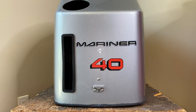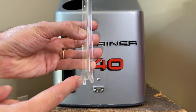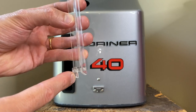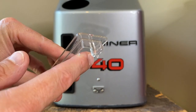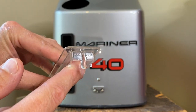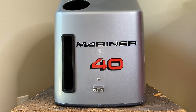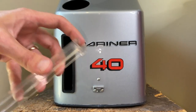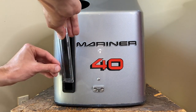The last thing you want to do is force that acrylic lens into this rubber seal without lubrication and break it. Not good. However, directing our attention to the acrylic lens, and you've got this little slot here, as you see. And on the opposite end, a little tab or probe. And that is what that aluminum plate and lock washer seat onto inside the cowl to hold it in place. However, this little slot right here, that is the bottom part. We're coming in and just sliding it down carefully,